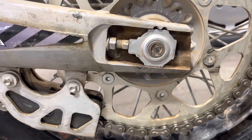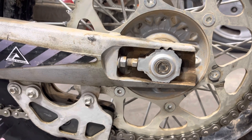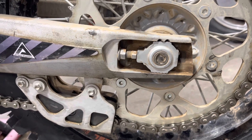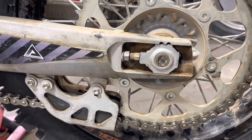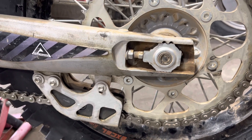This side is sitting more forward for sure, so I'm tempted to loosen it up and thread this adjuster a little bit out to get the wheel into better alignment, because I'm not totally happy with how they did it.